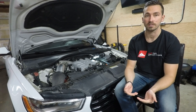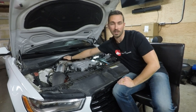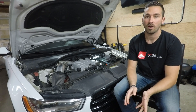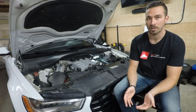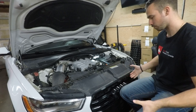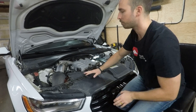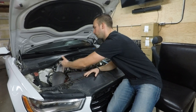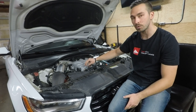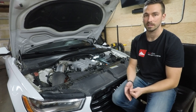That tells us a few things. Feeling a hot air intake pipe is not an indicator of IATs. A hot air intake with no heat shield won't matter that much — as you can see, that's what I run. It doesn't matter that much because when you've got cool air coming in, flowing through here, it's flowing across the pipe, cooling it, and it's also flowing in through the pipe, taking that heat as well. Yes, it's going into here, but then it's cooled as well. Heat shields are nice for blocking some of that radiant heat in the engine bay.